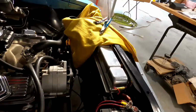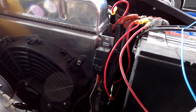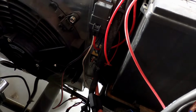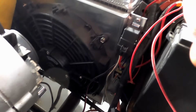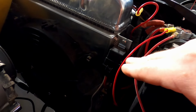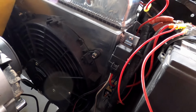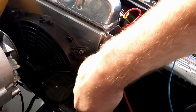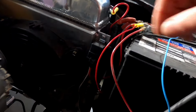off of that relay. Now I was looking in this area where there is not a lot of real estate to do my three relay setup. Now the other shop put in one of these 30 amp circuit breakers. Cool. I had a fuse. Fuse is good enough. Circuit breaker is decent. But where I am now going to change these from both being switched on high speed all the time to a low speed, high speed, I will have three relays to mount, and each fan is going to be controlled by a relay. Will have their own dedicated power wire. So what I think I'm going to do, instead of mounting them side by side like I usually do, I think I'm going to use this real estate here and do them vertically. And that should save a lot of space, clean up a lot of stuff.